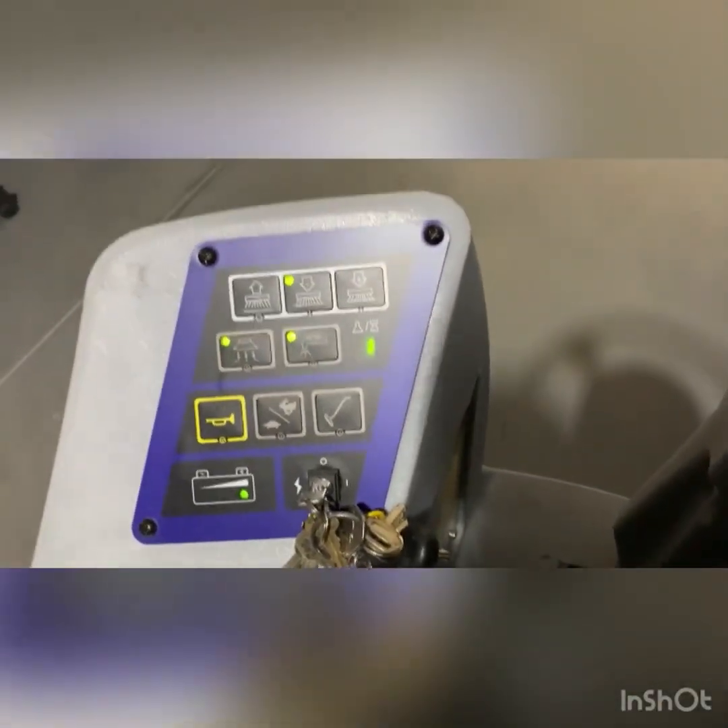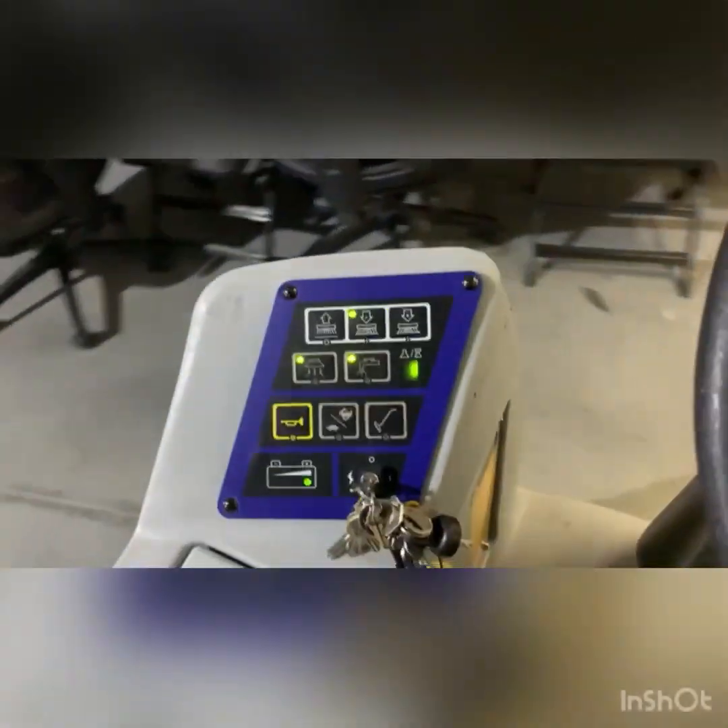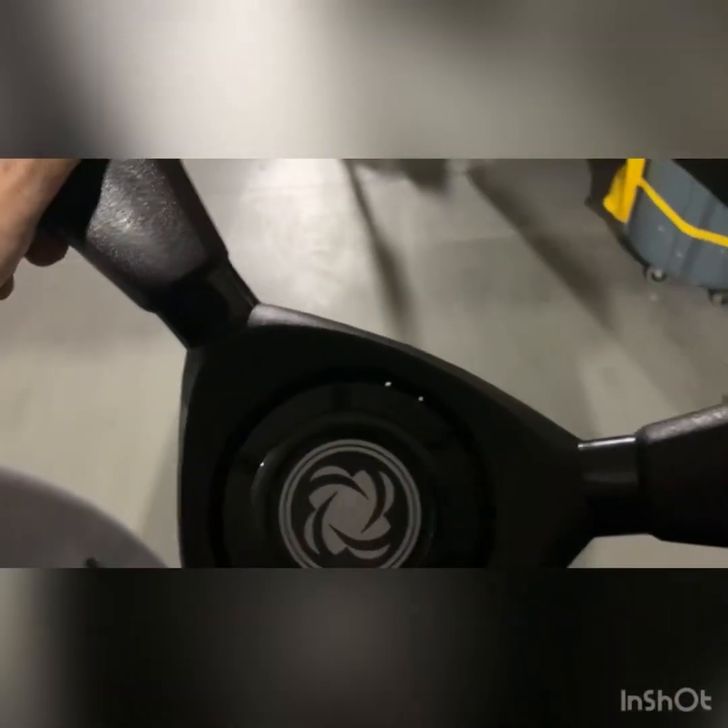Another potential source of noise: going up a transition or ramp. It's always suggested you go side by side, either up or down a ramp — not straight up. The initial shock is not great. I'm going to check the deflection of the blades — that's pretty good. Keeping it at setting one, there's plenty of pressure on the deck and the bristles are doing what they're supposed to. You don't want to crush the bristles down because you're not extracting any dirt from the surface.